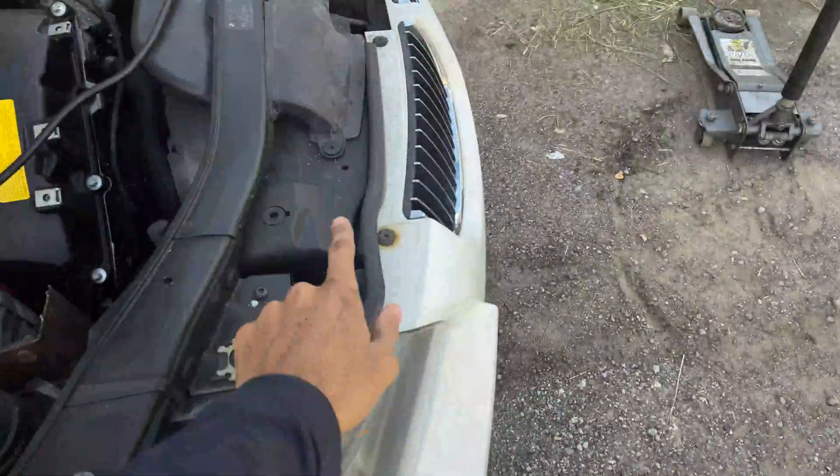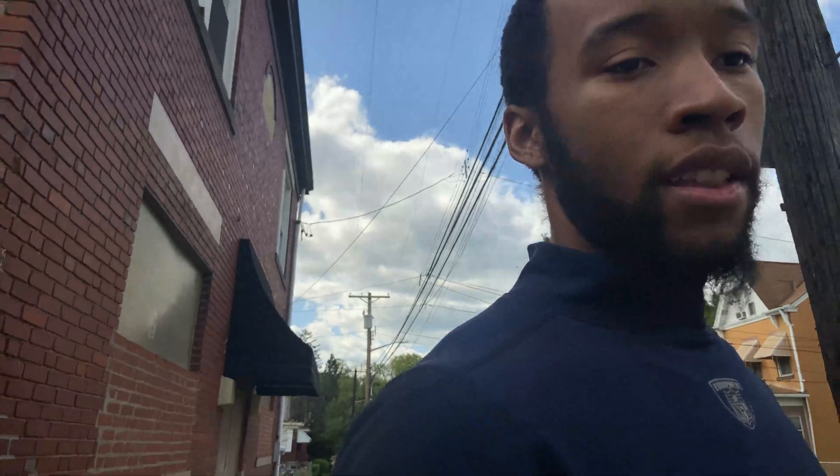After you do that, you're going to want to go under here and take off your belly pan if you haven't already. To drain coolant: manual cars have a drain plug, but on automatic cars you're going to want to have your bucket ready. Come over here to this silver guy, pull this little clip, pull this out, and it'll drain the majority of your coolant. Manual cars have one — I think it's on the driver's side — just a little drain plug you can loosen up and drain your radiator. Once we get that done, we can start pulling all these lines off.